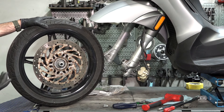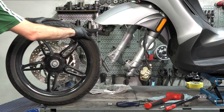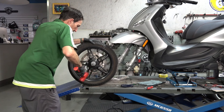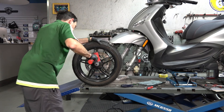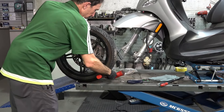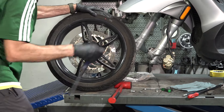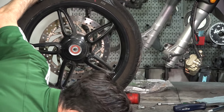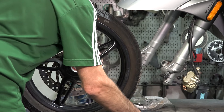Next I'm going to show how to change the rotor — you could skip past this section if you like. One other tip you need to know about is when you balance these wheels, you either need to use the original axle, or if you're using a set of balancing cones, you could just knock the dust covers out of the way. They have a dust cover that just comes right off — I'm doing that with a mallet. Once you remove them once, they come out pretty easy. Sometimes you can even use a flat-bladed screwdriver and give it a little pop and both sides will pop right out. If this is the case, now you can do a precision balance by putting a set of cones in here. If you're taking this wheel to somebody, you may want to remove these spacers. It's a perfect opportunity to clean these up and put a little bit of silver paint on them.